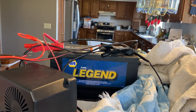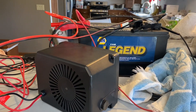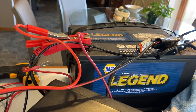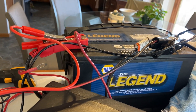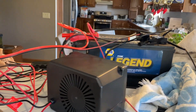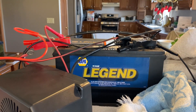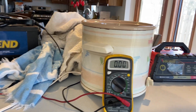Reduce your charging and discharging rate a bit so you don't overheat the battery, because you don't want something called plate buckling. It's hard to cause in batteries like this since they have thicker lead plates designed for high-amperage starting use, but in some batteries if you change plate temperature too rapidly — or discharge them too much — buckling can happen. This battery warmed up to temperature over about two hours, so it wasn't fast. I also wasn't overdrawing; I would stop drawing when I hit about 11 volts, sometimes letting it drop to about 10.5 volts, then start recharging.